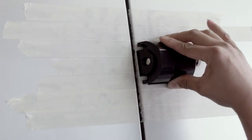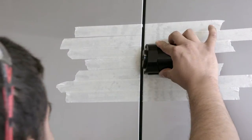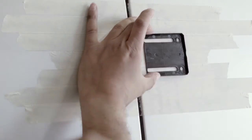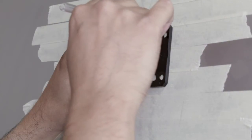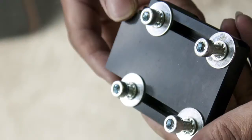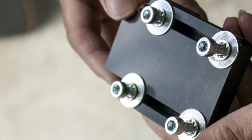We can now open the side sliding door to ensure there's no obstruction. At this point, we can manoeuvre the lock body to find the most suitable clearance position. Once confirmed, we can remove the unit and, whilst holding the gasket in position, mark the 2 holes and the 2 slots on the masking tape. The ArmaDLock requires 4 fixings to be utilised on both sides for optimum strength.